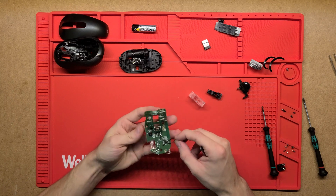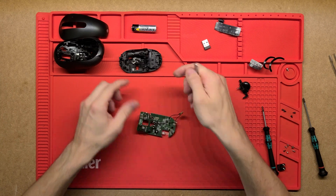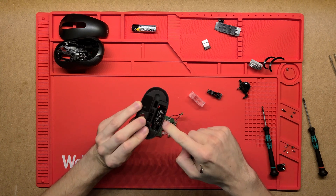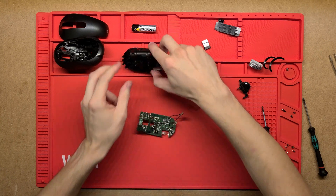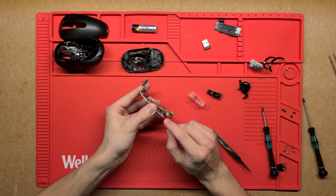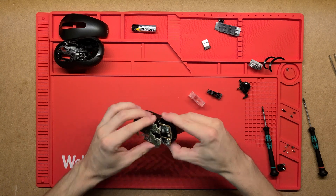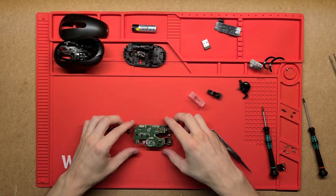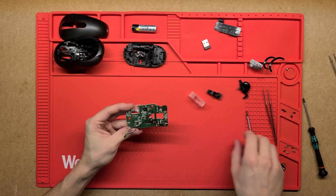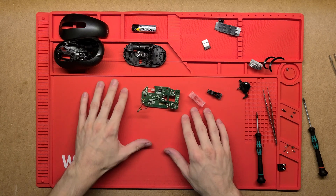And then you've got the battery terminals up here — springs soldered straight onto the board that fit into that slot, with the case itself holding the battery in place. This connection isn't mechanically very secure on its own, but once it's mounted onto the plate and screwed to the plastic it doesn't move around too much. That's a Microsoft wireless mouse — now you've seen the inside of it. Thanks for watching.